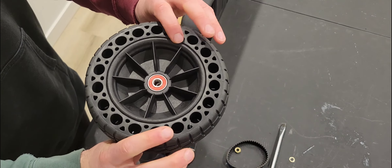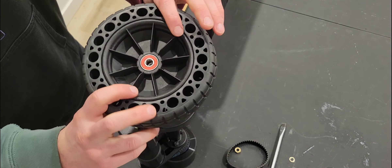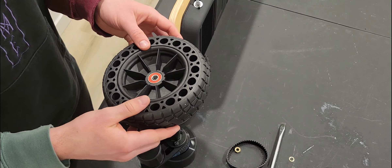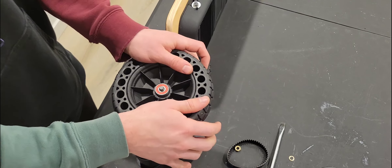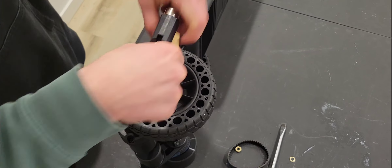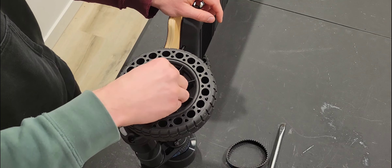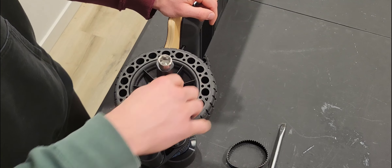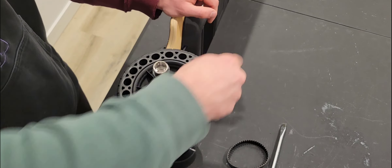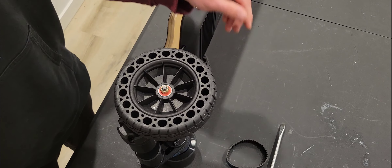Final step. The Summit AT wheel has two sides — this is the outside, and this side fits into the pulley. If that happens, use this to push it back down. Washer and nut back on. You can follow this same process on any belt drive board — this goes for the Summit XT model as well, so the same process applies on the Summit XT.